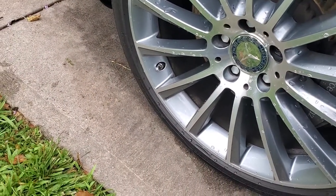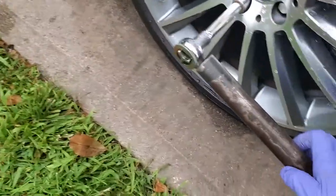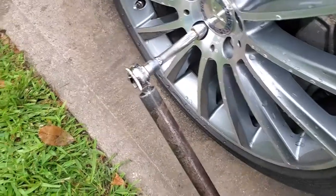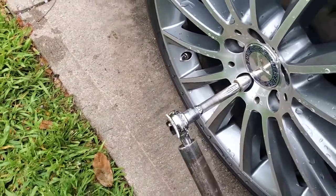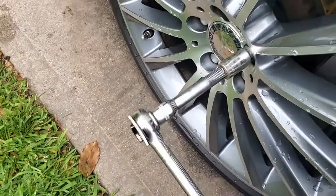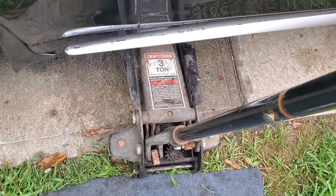We're at the tire. What we're going to use is a 17mm socket with a 1.5 inch extension. I'm going to put this in here, and what I'm also going to use is this for leverage — for those of you who are having a hard time trying to get off your bolts, this is what I use, and this will actually give you some leverage. We're going to do that with all the nuts to loosen them. We don't take the bolts all the way out — we just want enough so that when we jack up the car, it's easy just to take the wheel off. You probably want to get a three-ton jack; these cars are heavy and you want something that's stable and secure.